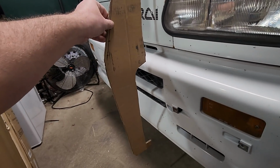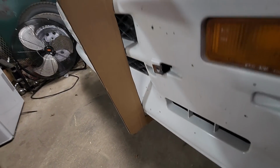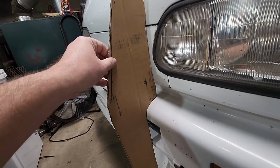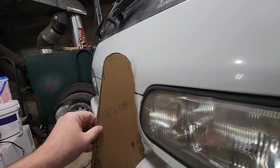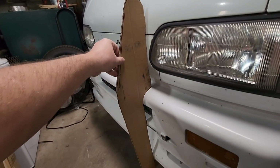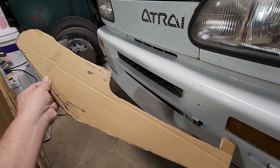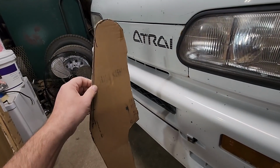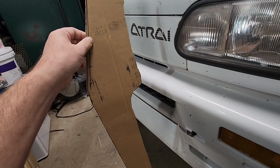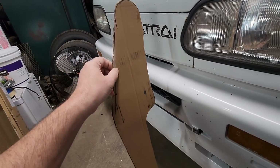Working on my front push bar, old school style, since you can't find any anymore. Plus it won't be the right width, of course. But that's about what it's going to be. Now you got some plate steel I can cut the two ends out of. Round pipe on the top, flat 6-inch C-channel on the bottom so I can mount the winch. And a couple lights, of course.